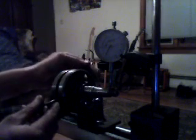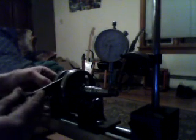In front of me is +1. Below me is +6. Behind is +5 now. And the top is 0. So the way I do it is because we're pivoting it on the seal face here. The lowest end out here, what I look for is always the lowest reading, because the pivoting is here. So if it's the lowest out on there, that means, because we're pivoting in the middle, this web, which is the same one, I hope you guys can see that. So I'm looking at the same web.